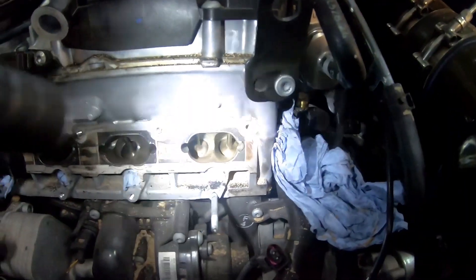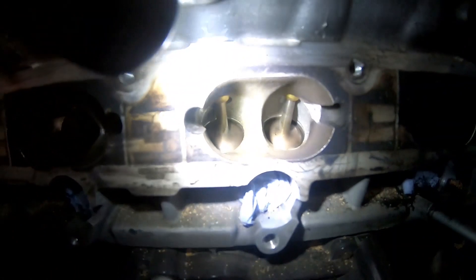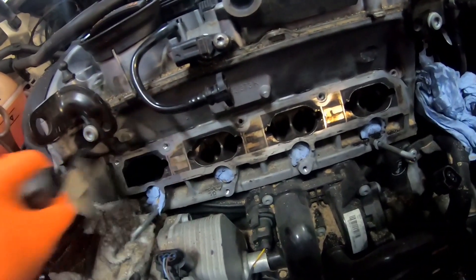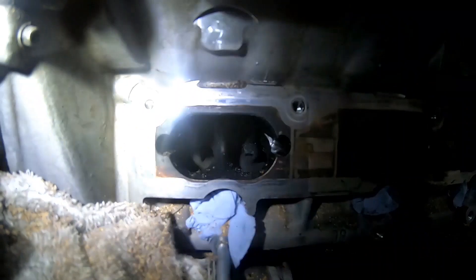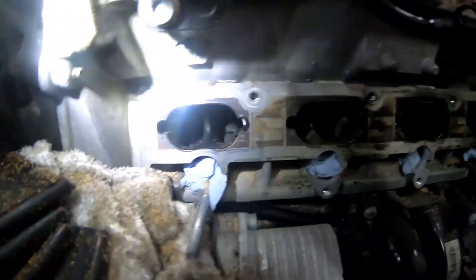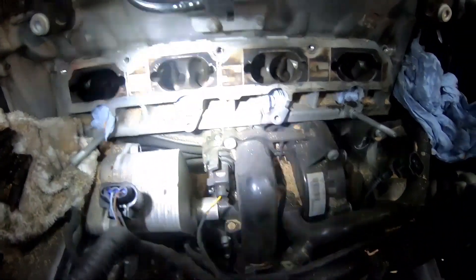That's pretty much done with these ports, so we're moving on to that final cylinder. It's come out pretty good - we've really struggled to get it much cleaner than that, so we'll leave them at that. What we'll have to do now is rotate the engine over and get this one to valves-closed, probably TDC on cylinder one. Then these other ones will probably be open, so we'll put a little tape across all three of those because we don't want to introduce any walnuts in there.